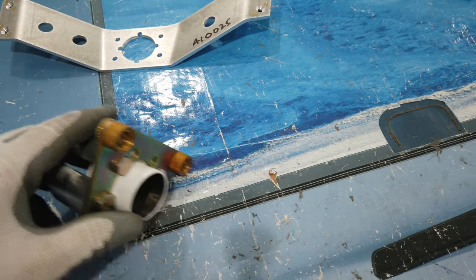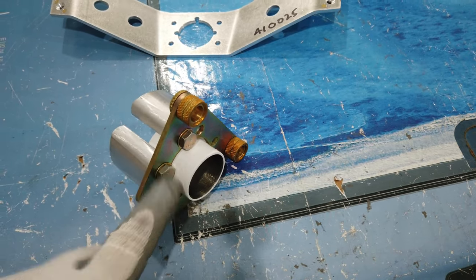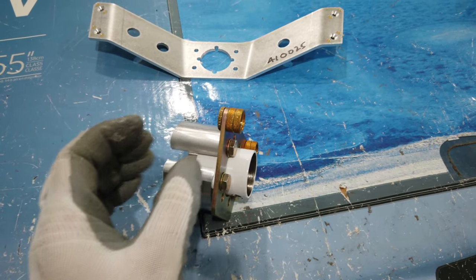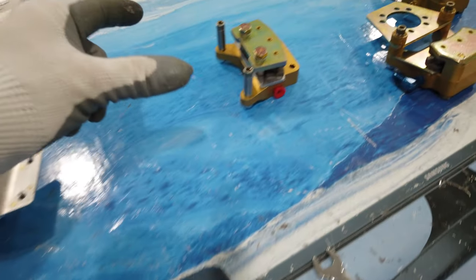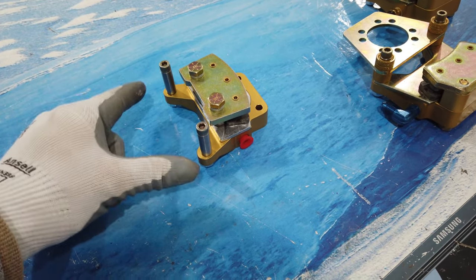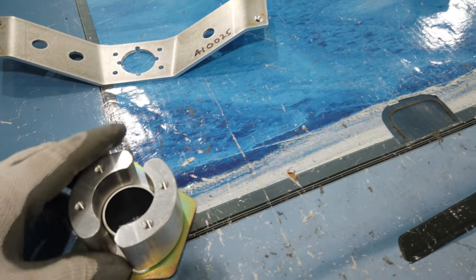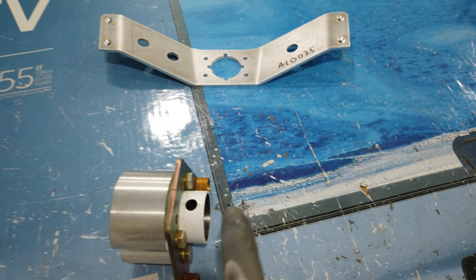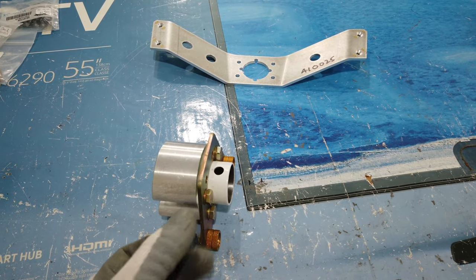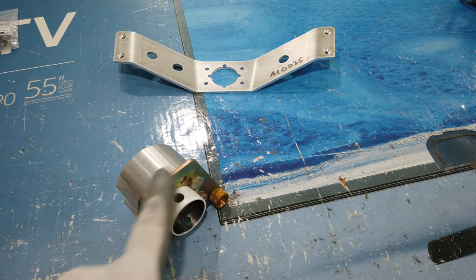The reason I say that is these holes here need to slide on the brake. If you start cranking on these bolts to pull all these pieces together, you can impart a partial bend on this bracket and it will not slide correctly on the caliper. Just like I've always talked about with other things, you want these to come together with no stress. You want everything to just fit nice, run the bolts in by hand, and then just tighten the bolt. You don't want to rely on the bolt to draw things together and potentially bend and warp things.